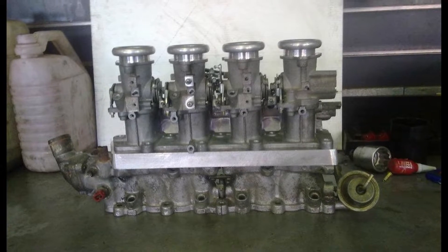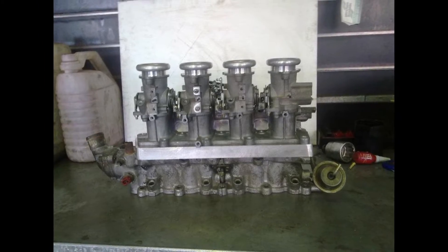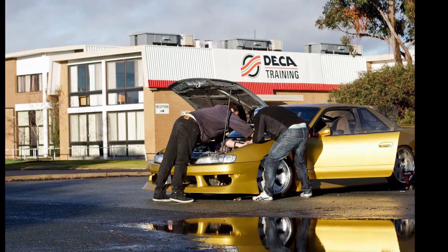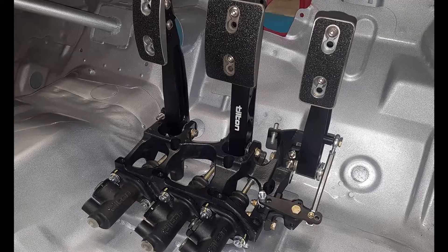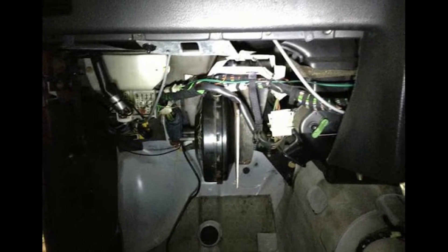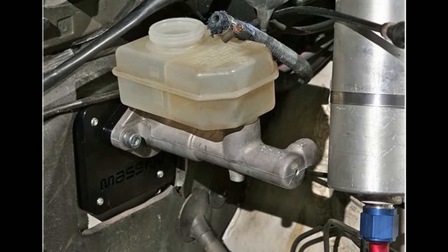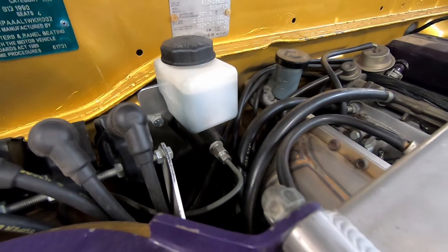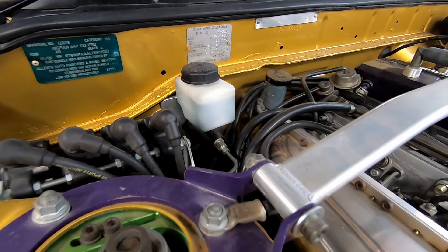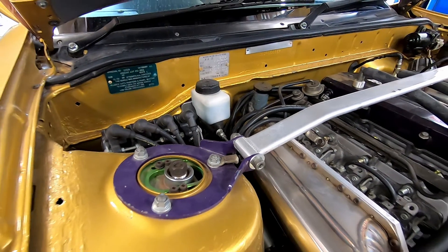I made the mistake of rushing before an event to make big changes to my setup, which led to even more rushing and making temporary fixes to get back out on the track. There are a few solutions to clearance issues like this: you can fit a pedal box with twin masters inside the cabin, run a remote booster, or run a booster delete kit with the stock master cylinder. But I decided to be super awesome and made a booster delete plate for a single compact master cylinder without correcting the pedal ratio, because the car was on the hoist and I was too lazy to pull the pedal assembly out.